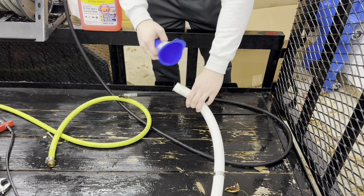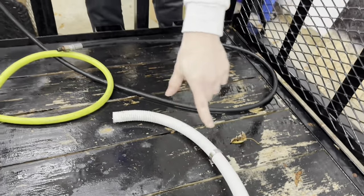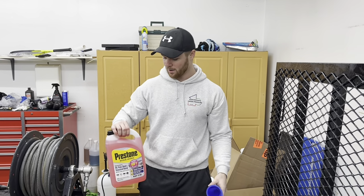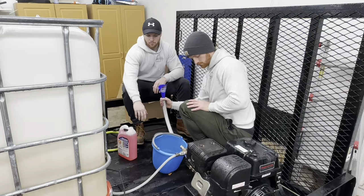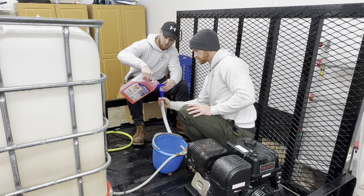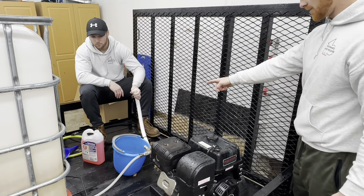So now we pop this hose and get that all out of the way. We're going to go ahead and drain all the extra water out of there. That's the inlet to our pump, so I'm going to have my helper hold that vertical and we're going to pour RV antifreeze — we just bought this Prestone stuff from Walmart — and we're just going to fill that tube up and cycle it through the pump. We got our bucket sitting at the outlet from the pump and this is the inlet that we're filling.